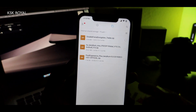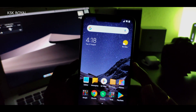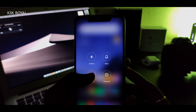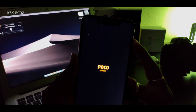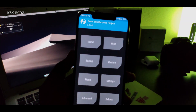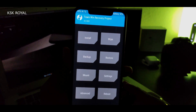Once that's done, reboot your phone into TWRP recovery. Hold the power button, click Reboot, then tap to reboot again. While it's rebooting, keep holding the Volume Up button until your phone boots into TWRP custom recovery. When you see that, go ahead and let the keys go.